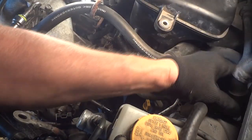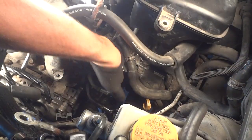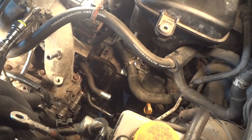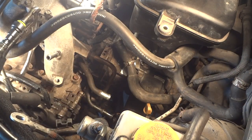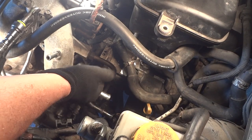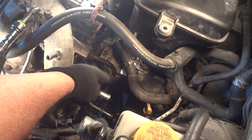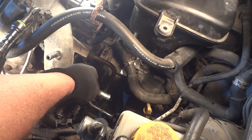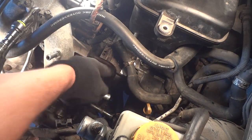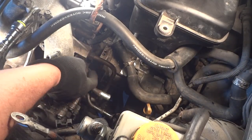I've got most of the antifreeze drained out — you'll probably lose a little bit back here. Our plug is right about there, so we'll get our tool. Now I need to mention this: I can almost get the plug out but the tool is going to hit part of this EGR valve here. This tube actually comes up — I can take this out, I've had it out before. Yours may not have it — some do and some don't. They're usually pretty easy to get out. I'm going to put a ratchet on here or a big wrench and go ahead and take this out, and that'll give me a little more room to get in there and get that plug. But if you don't have this, you're good.